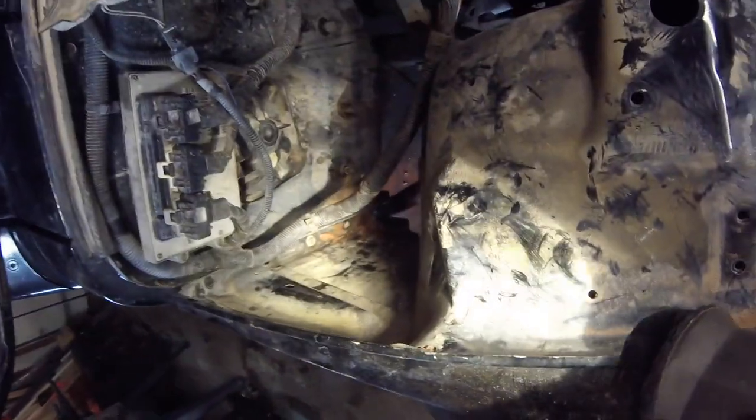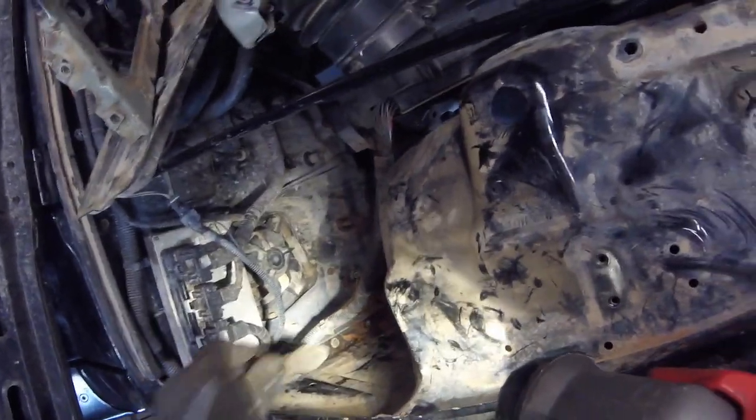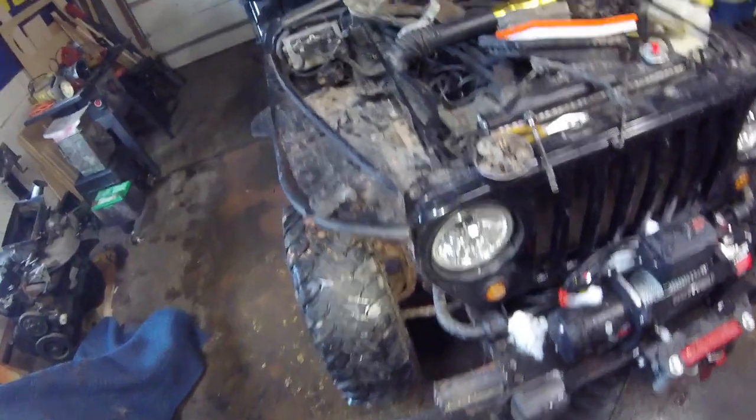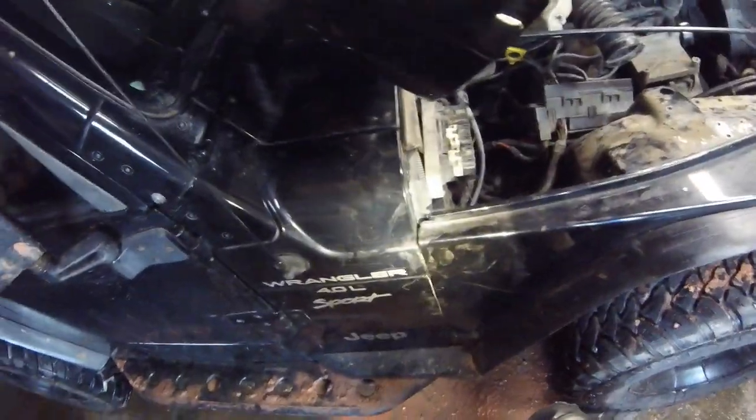As you can see, this does not line up with just using the holes in the fender, so those holes need to be widened up taller or another hole drilled right above them so the fender can drop down a little bit. You can see here where we're lining up up front — it's a little high, probably more like that. A little bit more to do: get those holes a little wider, keep messing with it until it's perfect, and then I can cut the hood to match, because I do not want that to miss a line.